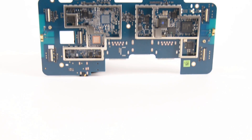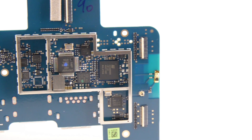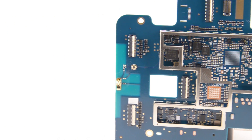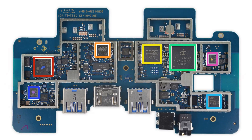On to the motherboard! We get to the crowded motherboard and find the ST Microelectronics ARM Cortex M0 microcontroller, the Toshiba-made 4K HDMI to MIPI dual DSI converter — also found in the Oculus Rift CV1 — and the Alpha Image Technology System-on-Chip with Image Signal Processor. To see the full list of chips, check out our teardown at ifixit.com.